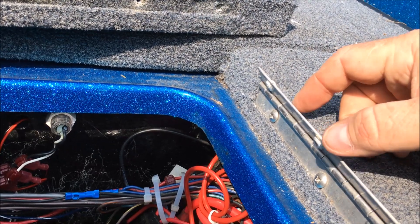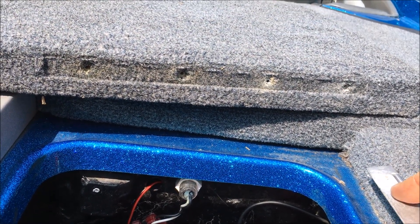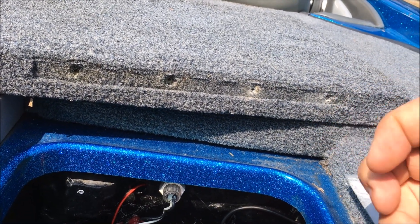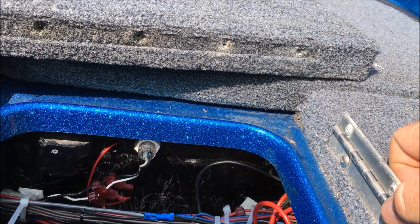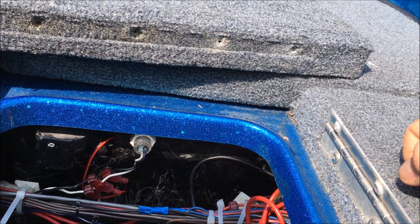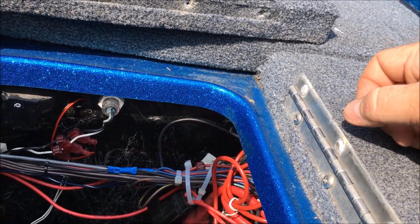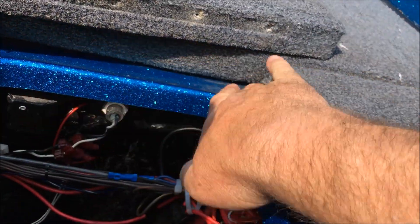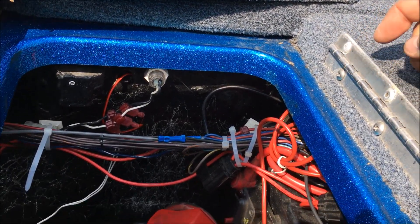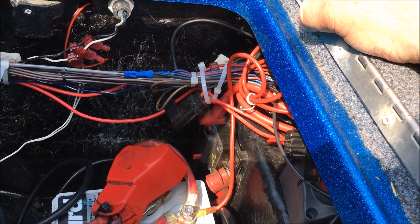It may make the hole a little bit larger, but that's okay, because the key here is we're not going back with the same kind of rivets. I've bought good sturdy stainless steel rivets — to the point that I'm a big guy and I have a hard time getting them to pop with a one-handed pop rivet gun. So I had to get the one that uses two hands, which has more of a clamp to it so you can get them to pop loose.